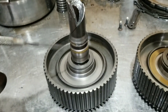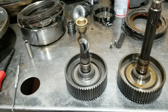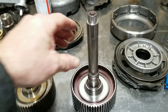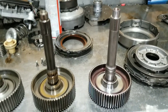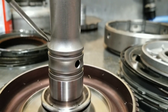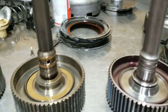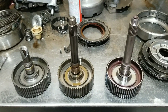As you can see on this one, you can actually see the crack right here. It twisted. When that lockup applied, that shaft could not hang in there - it was so aggressive it just snapped right off. If you look inside the new shaft, the wall thickness is a little bit fatter too - they addressed that. You can see side by side that the factory one is cut down just a little bit more.